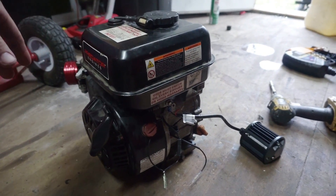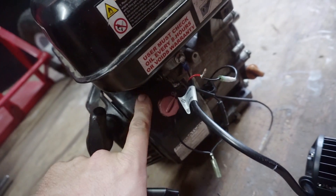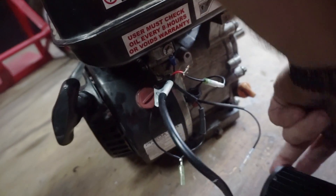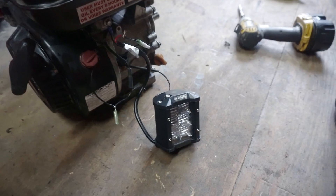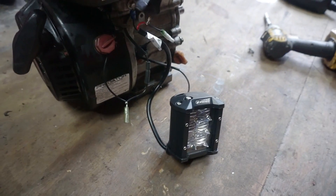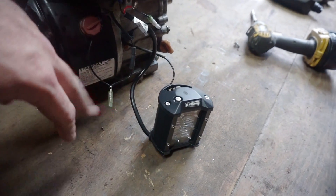What I want to show you before I end this video is the actual charging coil setup on the Predator engine — show you how it runs now that the governor is deleted. The throttle response is ridiculous, it's real rapid — I can't wait to get it back on the trike. I went ahead and hardwired the light. You have two charging coils inside: one coil does one output and tagging them together gets rid of the flicker — or cuts it down where you don't see it as much. That one light there is going to be the headlight for the trike. I'm thinking about putting a switch on the inside of it so I can switch it on and off from the side of the light itself.